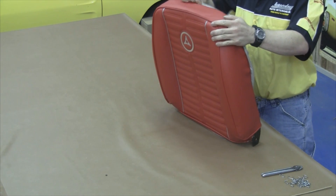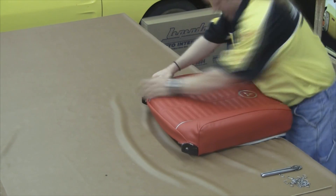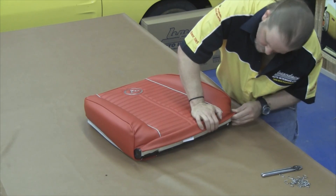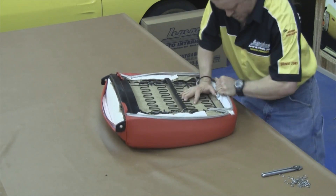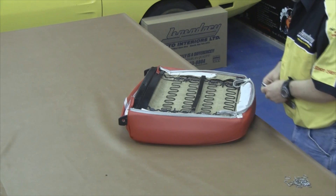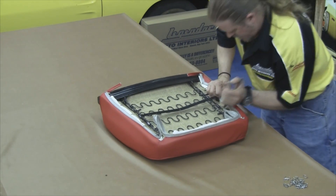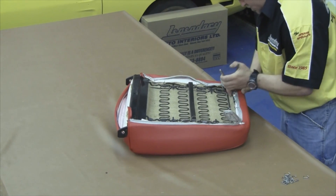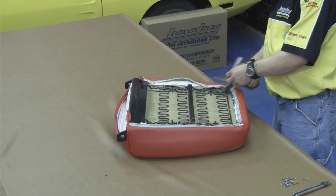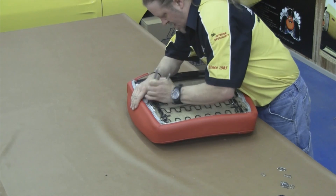If at any point you want to have the professionals at Legendary Auto Interiors do the work for you, give us a call at 1-800-363-8804 or visit our website at www.legendaryautointeriors.com. On the bottom edge of the seat cover, the stretch panel has a small pocket sewn into it that you need to insert another piece of paper-coated listing wire. After our corners are all anchored, go back through and make sure the seat cover is installed symmetrically — not too far clockwise or counterclockwise. Once established, fill in between all the corners, starting with the top edge and then working your way around the seat. On the top corners, trim off any excess listing wires and then finish up the sides, attaching around the listing cord and around the seat frame.